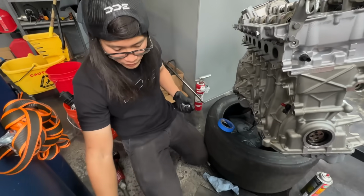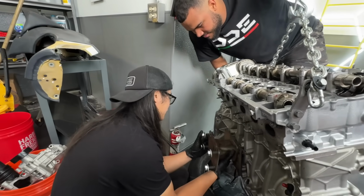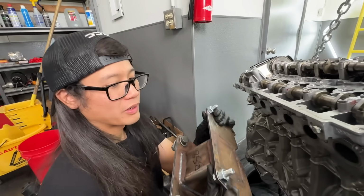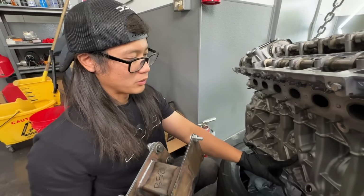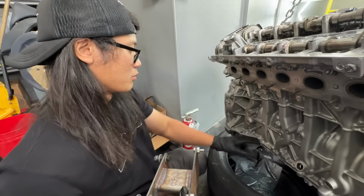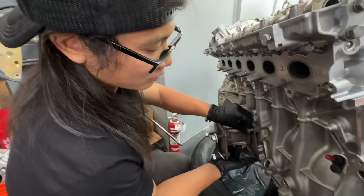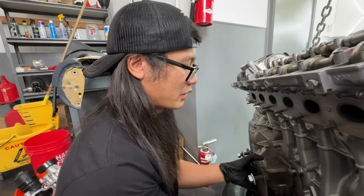So I just got this motor mount off, and then we're gonna put on that adapter. No, this is just the mount for the engine stand. All right, so on these top two holes, we have to use these nuts as basically spacers, because these top two mounting holes for the engine mount are actually recessed more than the bottom. So now you can see the plate sits flat, and then we can mount it to the engine stand once we get it high enough.